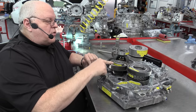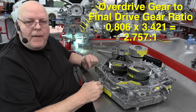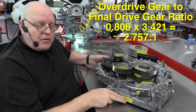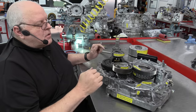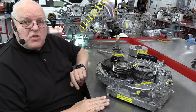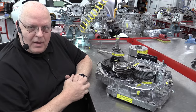With the overdrive gear installed, the engine rotates the 67 teeth of the overdrive gear driving the 54 teeth of the counter gear — overdriving it because the overdrive gear is bigger — with an overdrive gear ratio of 0.8059, a 20% overdrive. That drives our 3.421 gear reduction for the final drive. Multiplying those together gives an overall engine-to-tires gear ratio of 2.757, on everything except the CRV hybrid. Engine only mode starts at around 62 miles an hour or 100 kilometers per hour and goes up to the top speed of the vehicle, because with an overdrive ratio of 0.8 you can't slow down very much without loading the engine too much.